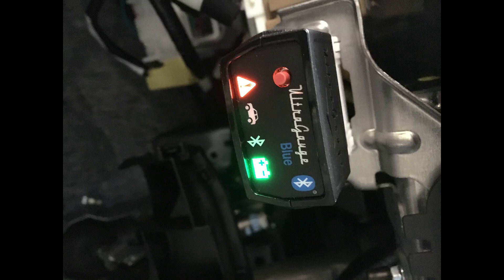A very good question I've seen asked on automotive forums is: can you leave the Ultra Gauge Blue plugged in long term when the vehicle is unattended? The answer is yes and no. When the vehicle is turned off, it's not trying to communicate via Bluetooth or with the diagnostic bus, so those two power-drawing functions stop. However, two little LED lights remain illuminated. I didn't find any published parasitic drain numbers on their website, but if you have a healthy battery you can probably leave it plugged in for weeks. If you're parking in a long-term airport lot, I'd suggest pulling it out and throwing it in the glove box — but it's plug and play.